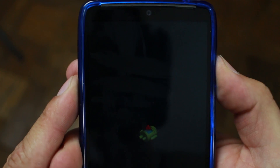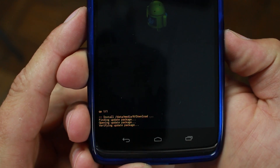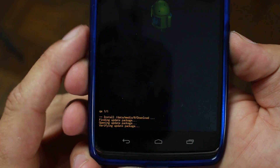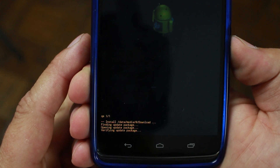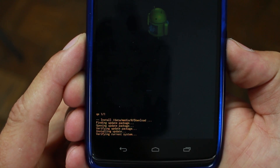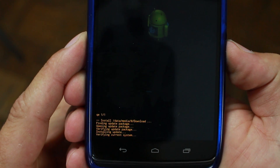Once you select it, you can see it going through the steps. This update is almost 800 megabytes, so it's going to take a while - be patient and let it go. If the OTA update aborts or fails, a couple of things could be happening: one, you have root access, which will cause it to fail. Two, you might be on the wrong build number - you need to be on SU2-12.